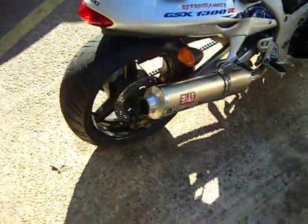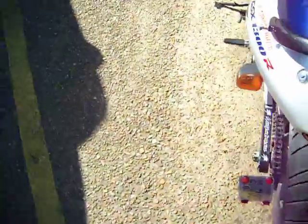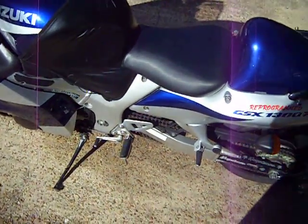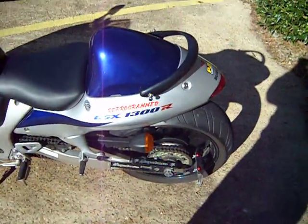I also had the bike re-geared. I believe I stayed with the stock rear sprocket and then I just went down one in the front. So that kind of gives me a little even balance, you know, keeps me a little even.